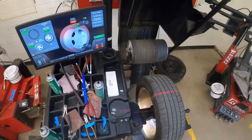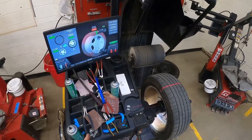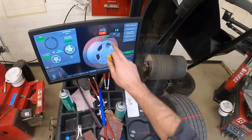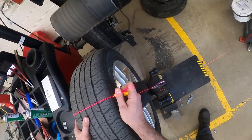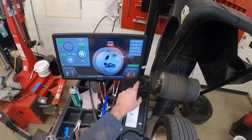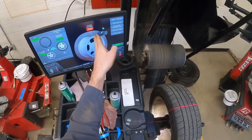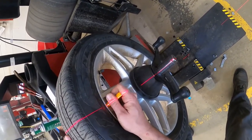I'm going to mark the two locations. They're straight across from one another. It's asking me to mark a line on the tire at the top because that's what it's prompting me to do on the screen. I'm going to click on servo and it's going to flip it around. Now you can see the chalk mark is positioned on the rim, and now I'm going to mark the rim with chalk as well.